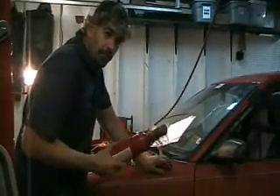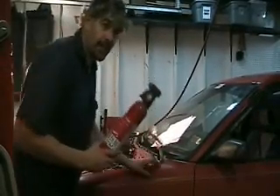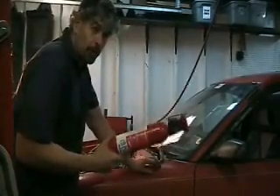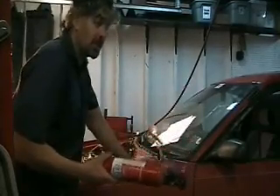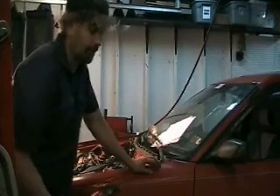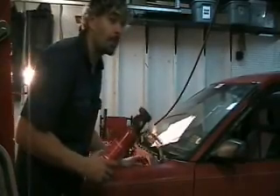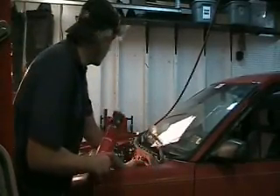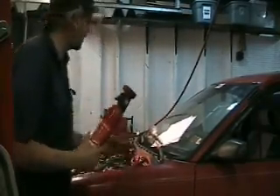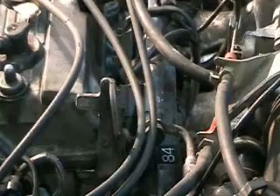Before we start it, we don't want to get too excited — safety first. What we're going to do is turn the key to on a couple of times: turn it on, wait a couple seconds, off, on — don't start the engine. That's going to run the fuel pump, obviously if you have an electric fuel pump; if you have a mechanical fuel pump it won't matter. The idea is to prime the system with fuel — it'll help with starting, and also when the system is full of fuel, that's when we can find leaks before we start the engine. I've got my fire extinguisher handy. Here is my high pressure fuel line connection and I see no leaks there and no leaks anywhere along anything I've removed.